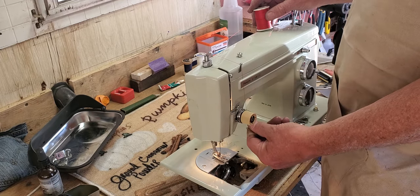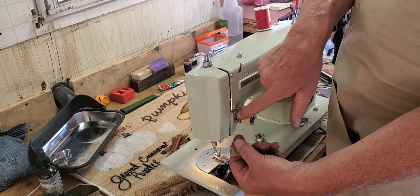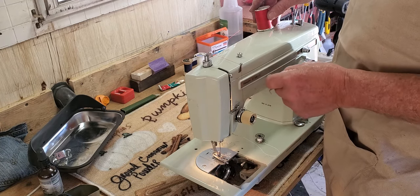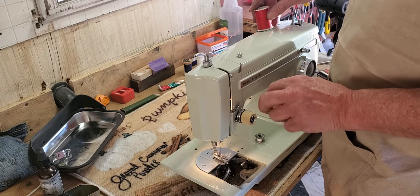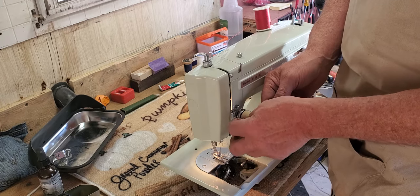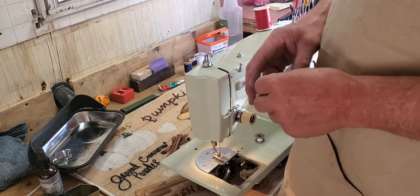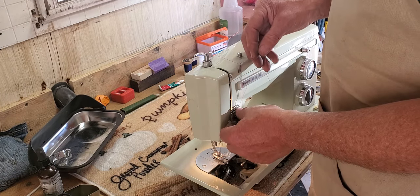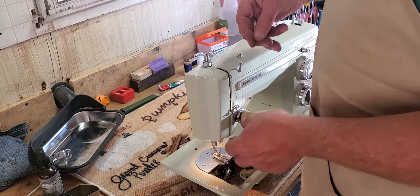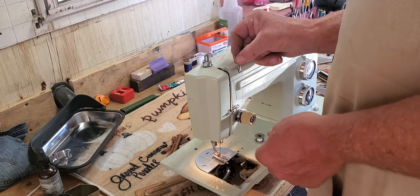So go in between the discs of the upper tension, all the way around, and pick up this thin check spring. Pull the check spring up until the thread goes into the notch at the top of the tension assembly. Then make sure your tension spring doesn't stick up there. It needs to be down here where it can put a little bit of tension on the thread between stitches. Go into the thread guide above the tension assembly. Go through the take up lever from right to left.